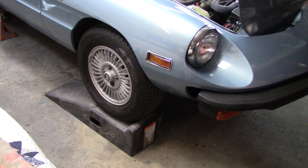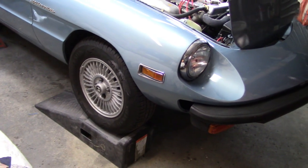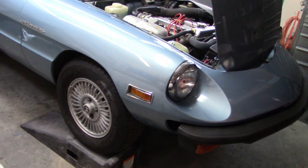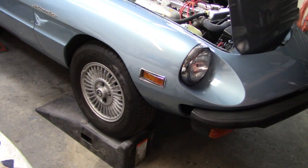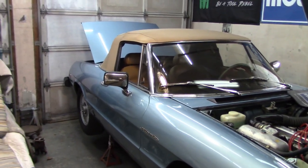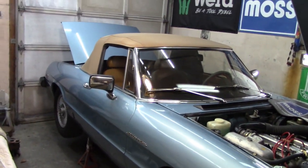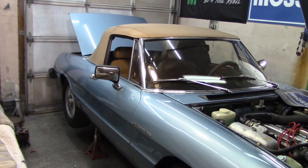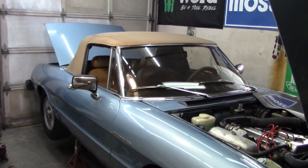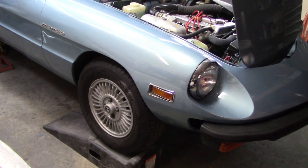First thing is to get the car up off the front ramps, loosen the lug nuts, take the four wheels off, get the car up on jack stands at the front, remove the ramps, then go to town removing the front shocks first. We'll go easy to hard - the shock installation on the front is much easier than the rear. The rear requires a little bit of disassembly of the interior; you have to pull the shocks out from the inside of the car through two plates.